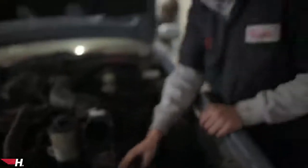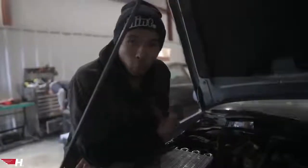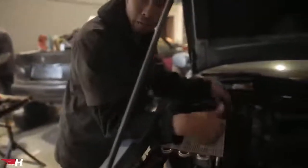I need to grab some more hose clamps, but I have one line for the power steering cooler run and clamped down, barbed off right here. Dylan mounted it right in front of the radiator so it's basically a straight shot for both lines. Let me walk you through all the coolers on this car: we have our Megan Racing radiator cooling the engine coolant, a power steering cooler — a regular trans-saver cooler — an oil cooler for the turbo oil, and lastly our tranny cooler.